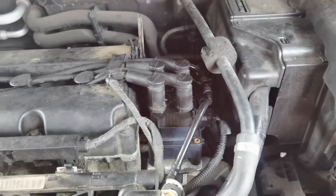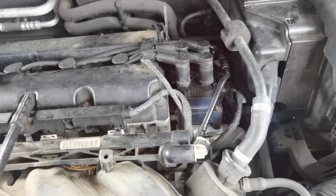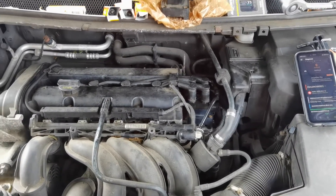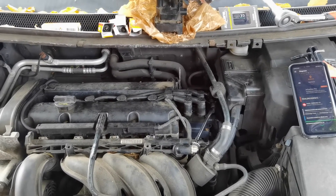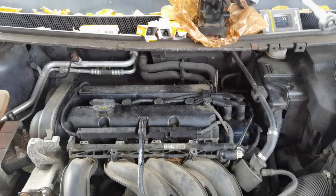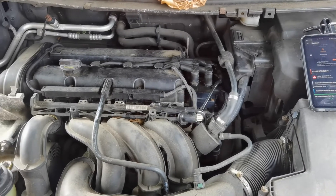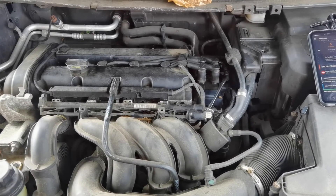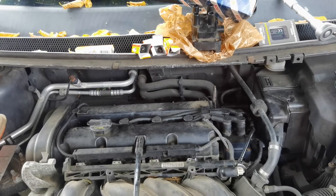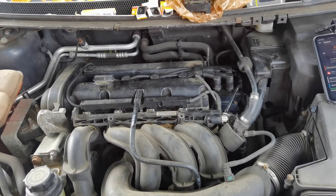With the coil exchanged it first looked like we still had a problem. One important detail I forgot: we got gas in the exhaust — when we had it running for about 20 minutes on the parking ground, the exhaust got a bit wet and smelled like gasoline. Also, if we had driven it in that condition, that would probably have damaged our catalytic converter and the exhaust system, which could have added quite some costs. I barely drove the car after we noticed that — maybe five kilometers with the check engine light on initially.